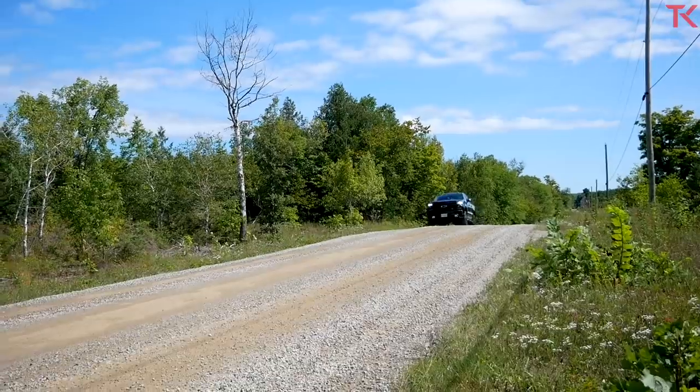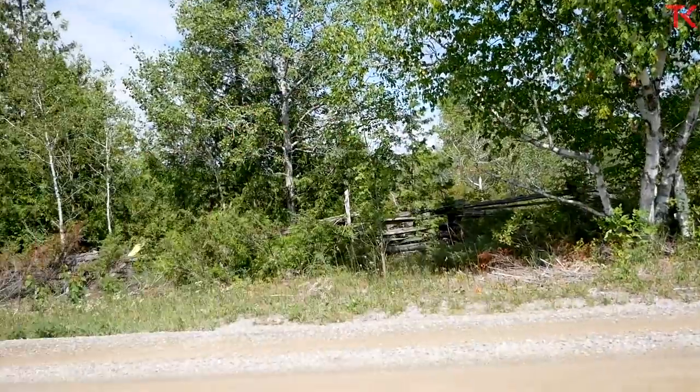We've got that thousand pounds back there in the bed, and with 1,497 pounds payload rating on this truck, with the load and us up here we're right at it if not a little bit more than the payload rating. That said, I think one of the biggest advantages of the Trail Boss is you're getting an off-road package and the lift but I don't feel really anything back there. Payload is still kind of a function of somewhere between marketing engineers and lawyers — this thing would handle way more than this thousand pounds.